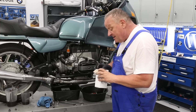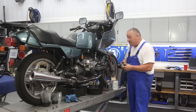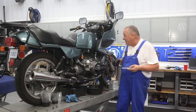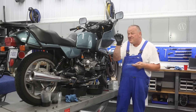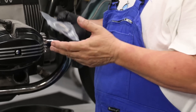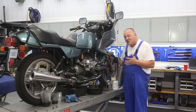I'm actually old enough to have done 600-mile services on these bikes when they came in for the first time, draining the factory-filled oil and filter — and there was no gasket, no shim; it was just the O-ring. That's all that's needed to seal here. However, when you get a filter kit, it comes with a new shim and gasket, and there's absolutely no harm in using those parts — put the gasket in just in case for extra protection against weepage. The shim is approximately equal thickness to the gasket, so the proper amount of tension is still on the O-ring. I'd go ahead and use them.